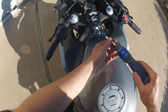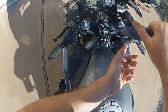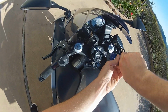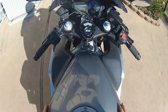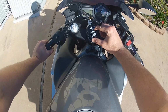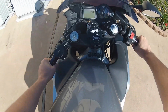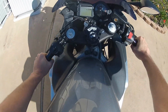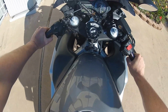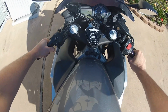Now we are going to go ahead and officially tighten down the bolts for the stabilizer. Now with your bolts tightened down, stabilizer is good to go. You want to set it to the middle setting. Should be about 10. And move your steering wheel back and forth. Make sure everything's moving correctly, looking alright. Actually looks really smooth. Definitely feels different. But different in a good way. Yeah, it feels really secure.